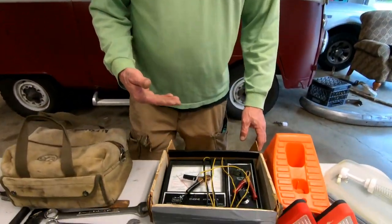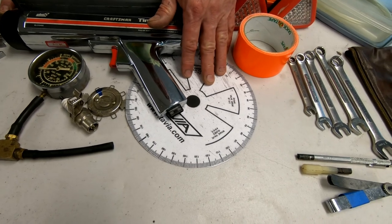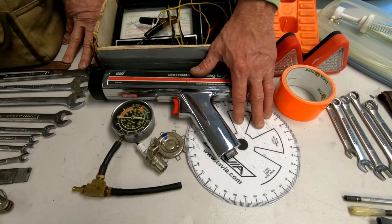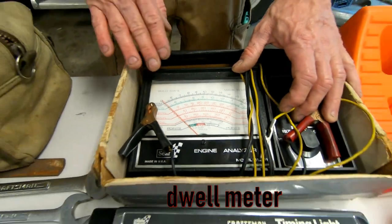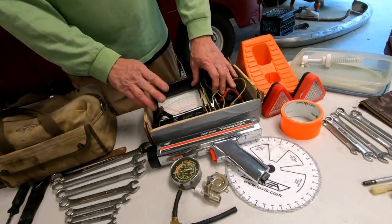Let's look at some things we also carry in our bus that don't fit in our bag of tools. First and foremost, of course, is a timing light. I always like to carry a timing wheel too, because I might run into somebody on the side of the road to help out — maybe they don't have a degree pulley. We can run this up there and at least get a pretty good eyeball, get them timed and ready to go. Before you do any kind of timing, if somebody's running points, you want to use our dwell meter here. This is an old vintage dwell meter from Sears — works like a champ. You've got to set your points first with your dwell, then do your timing, because otherwise it'll throw your timing off.